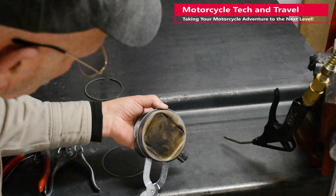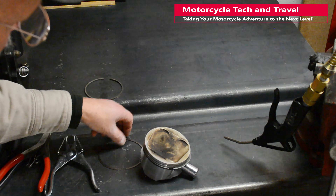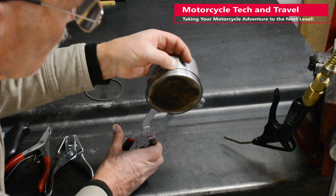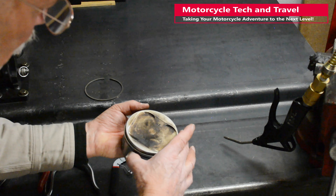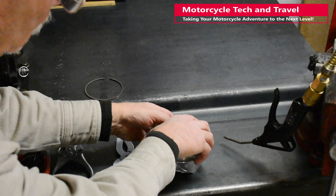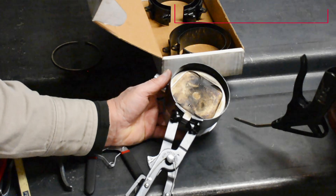If you are uncomfortable with hand removal and installation of piston rings, the ring expander is an option for specific diameter and thickness piston rings. Ring manufacturers often have their own recommendations and guidelines for installing new rings. Ring material ranges from cast iron to spring-like steel. Coated faces are common on modern rings. Molly and chrome rings each have their place — be careful with molly rings and avoid damaging the edges that must seal against the cylinder wall. Follow the guidelines in your motorcycle's factory shop manual, read the instructions included with the new piston rings, follow the ring and engine manufacturer's recommendations for positioning the compression rings, oil expanders, and expander side rails on the piston. Hold these ring positions while installing the piston in the cylinder — this is important for good ring seal and lasting piston ring installation.